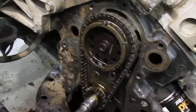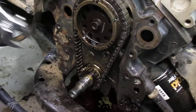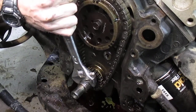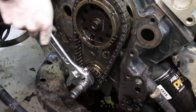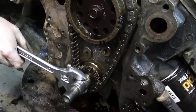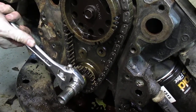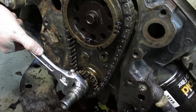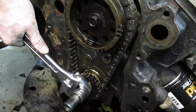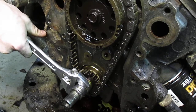Go ahead and turn the crankshaft against its normal rotation — counterclockwise — and watch how much it turns. Now reverse the direction of your wrench, go real slow so we can watch how much the crankshaft rotates before the chain slack tightens back up to the cam. Good — back off and do that again, kind of slow.